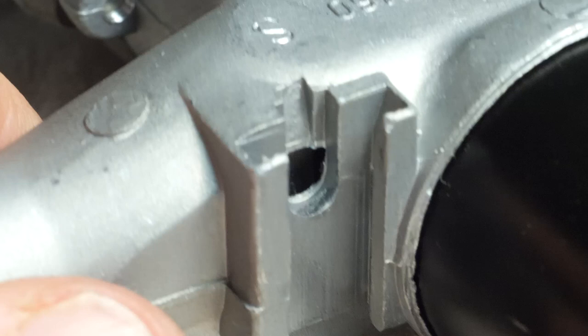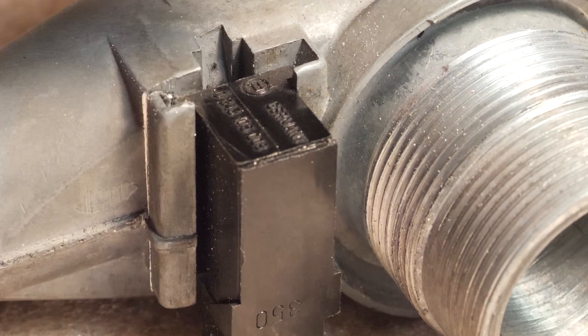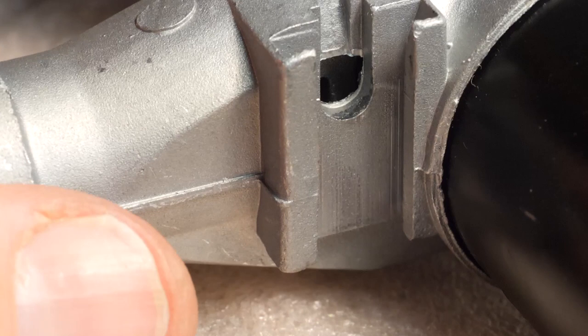I took it out of the car. There's a lot of videos about taking it out of the car and how that's done, and I'm not gonna dig into that, but this is the new switch, and there's this ignition buzzer. I think it's like a contact for the buzzer, which goes in this kind of channel. This is where I have to take that switch out of there and put it into the new switch housing, or the new steering lock housing.